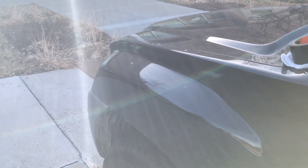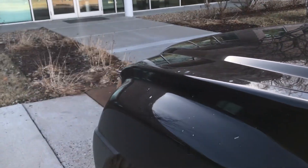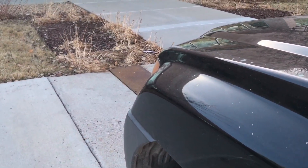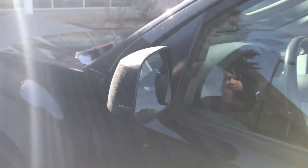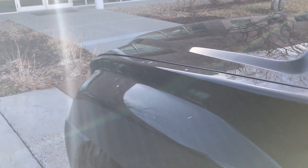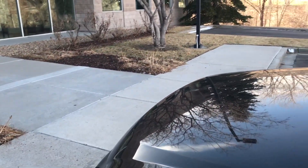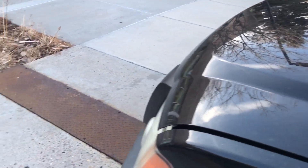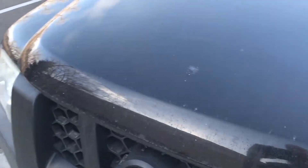Let me see if I can show you what's going on here. I'm just opening and closing the door and squeak, squeak, squeak. If we open the hood, pop open the hood, give the little latch a pull — clunk. Now let's close the door again. Nothing. It's either something to do with the latch or something to do with the little rubber grommets on the inside.